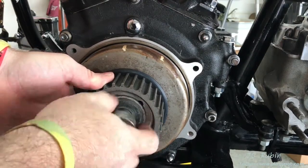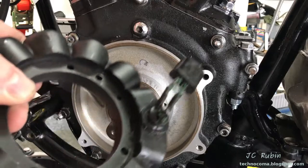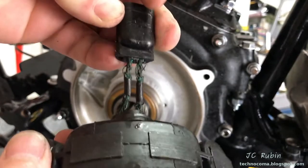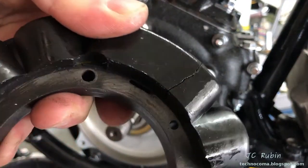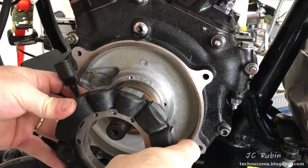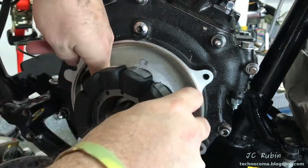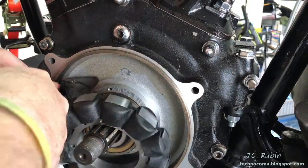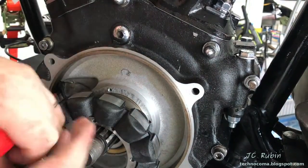All this was temporarily connected to rotate the engine and will now be removed. Here's the old stator I ripped out about two years ago - just to show you how terrible it was. Look at that crack - an accident waiting to happen. I picked up a new one from Excel. I'm going to drop it in with the plug making its way up into the case, worked in such that the plug is flush with the outside of the case. I'm moving it back and forth with a screwdriver trying to get it up there.